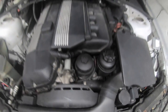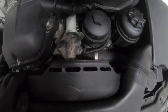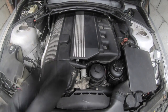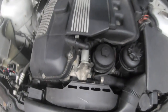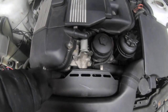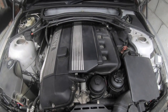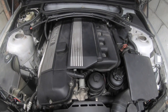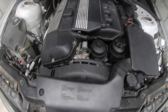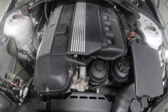The first thing that goes on these cars, which is a priority, is the clutch fan. Many people in the US believe you do not need this clutch fan. But in all the time I have driven M54 engines — be it the X5, E46, E39 — this fan has always worked. When the pulse-width modulated fan failed on my E39, I was using the aircon driving through hot summer, and only thanks to this clutch fan did my engine stay under temperature, even in traffic.